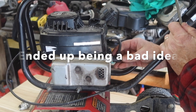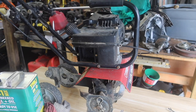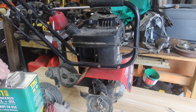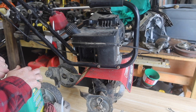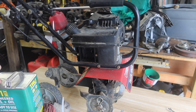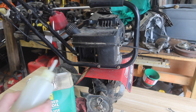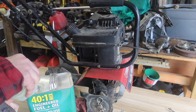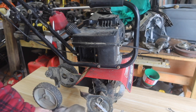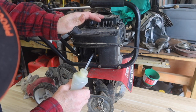Alright, so it has spark and the kill switch appears to work, and it's not scored. I am not a proponent of this True Fuel, but my local hardware store had this one gallon container on sale for five bucks. It's the wrong mixture though — this is 40 parts gas per one part oil, so even this is too much. We're just going to give it a try just a little bit to see if it runs. A lot of people have done tests of True Fuel and found that it's just not what it's cracked up to be.